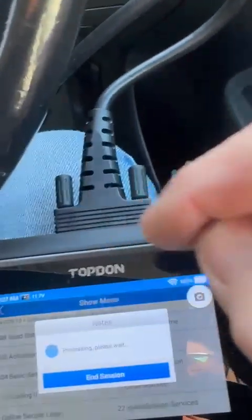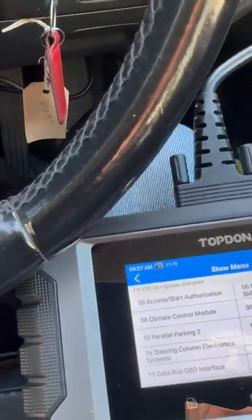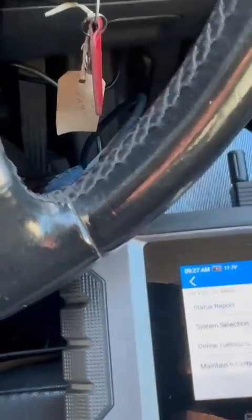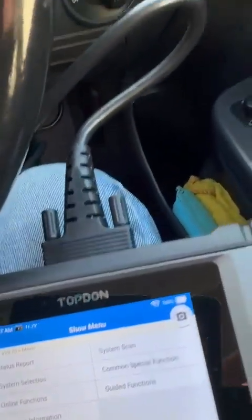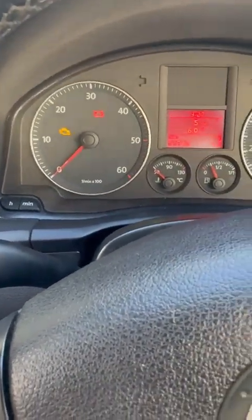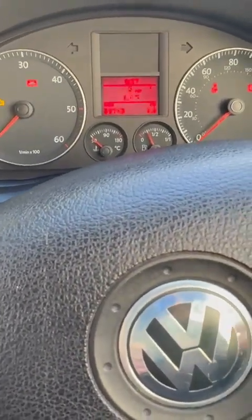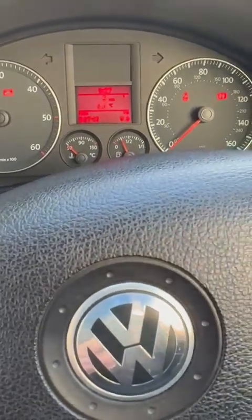You can code so many things with this machine, it's unbelievable. It's the best piece of kit I've had at the money — £189.99 — and it's so simple to use. Obviously when you've done a job like this, your steering wheel light will be on and the anti-skid light will be on, so what you have to do is make sure it's on solid ground and the tyre pressures are correct.